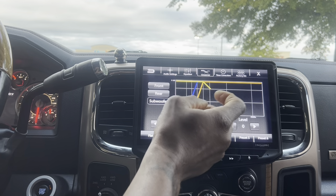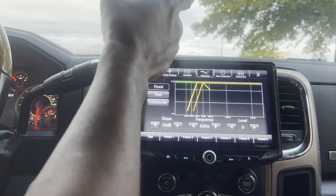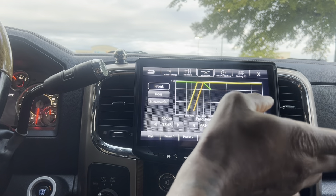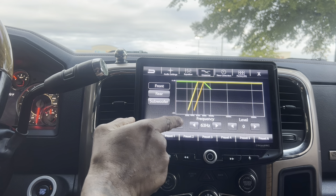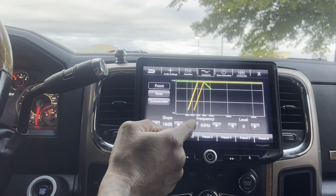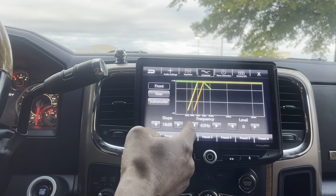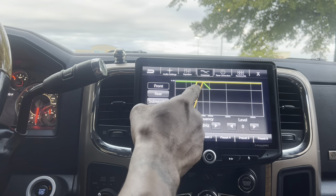With my crossover settings on my front stage — the dash and two on the door — the dash is still on my factory system, getting about 25 watts per speaker. The front stage is the two on the door. I have it crossed over, thanks to my DDA series, at an 18 dB slope. The crossover point is 63 hertz. I could take them to 40, but looking at the specs on the driver and how I like my system to sound, I'm bringing the bass up more on my front stage by crossing them over at 63 hertz with an 18 dB slope — so when I play real music, I'm not overextending my woofers in the door.